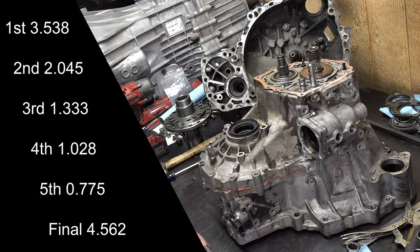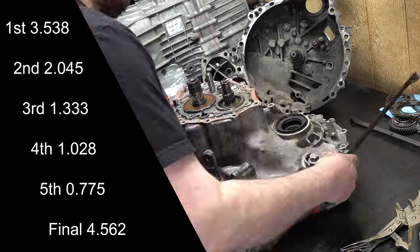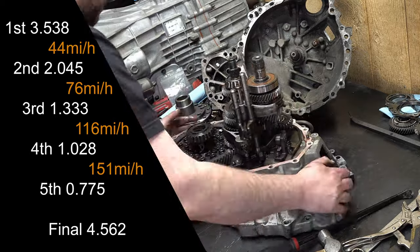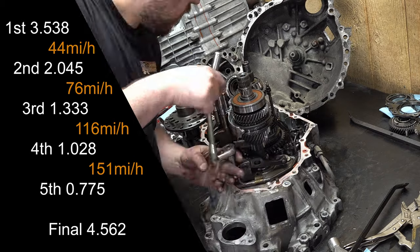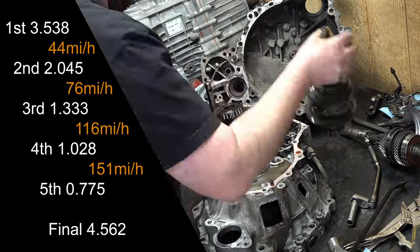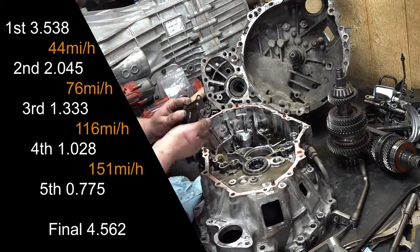What you're seeing now is the ratios for the transmission I built, and importantly the next revision of the engine is going to be spinning 9000 RPM, not 8000 RPM. With this gearing we can still hit a little over 40 in first gear, about 75 in second, and we'll have the 3-4 shift at a decent time and get to the end of the quarter mile before needing fifth. Fifth is really just a cruising gear if I ever take this to a drag-and-drive event. Since the main intent is drag racing, we're going to put a spool in here — there's no reason to have a differential just getting in the way.